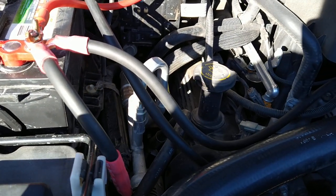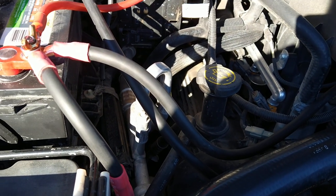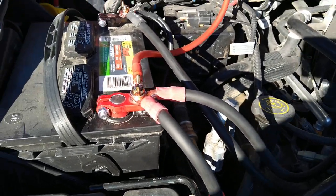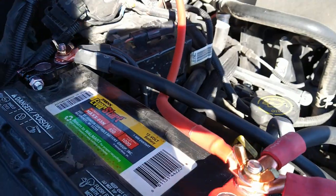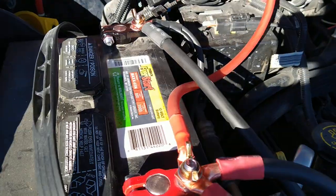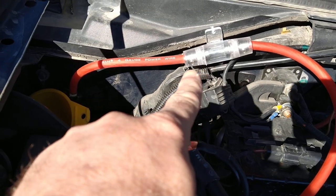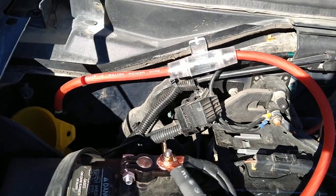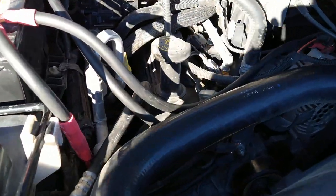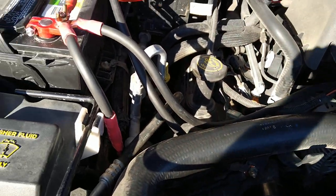This thing is rock solid now. I can idle at 650–700 RPM and key that one-by-four at night with the headlights on and there's absolutely no voltage drop. I did use four-gauge running back to the amp — if I had to redo it I'd use the same two-gauge welding wire, but it seems to be working fine. A more heavy-duty fuse holder is coming, but for now that's working great. Even with the stock alternator, this upgrade has helped so much.